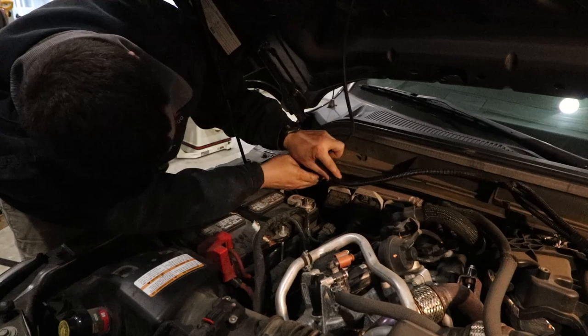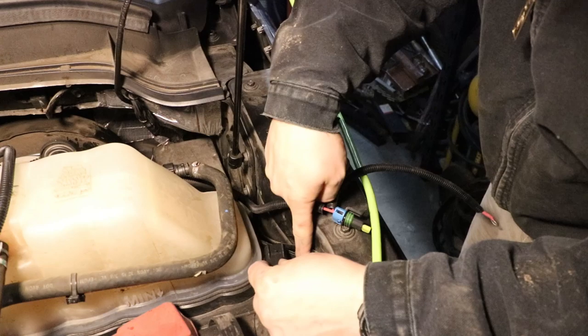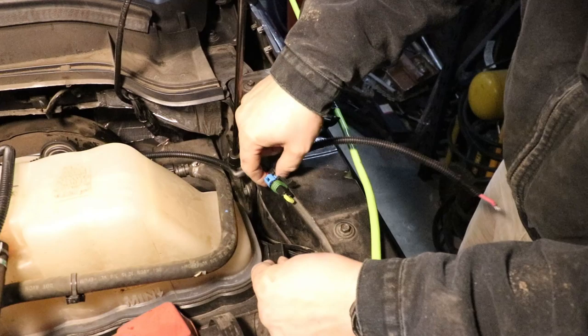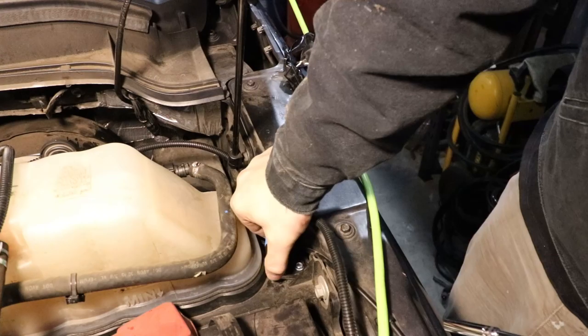This wire is the farthest one from the compressor, so I want to mount it first. A fuse holder. I can put that holder down in there like that, and then the fuse can go into it and be easily removed. So we can go ahead and run a self-tapper down through here. There we go. We'll snug that up just a scosh. There we go.